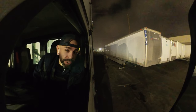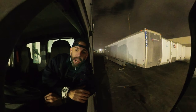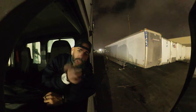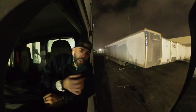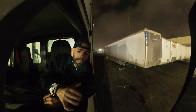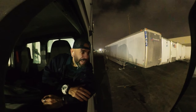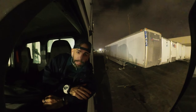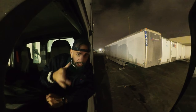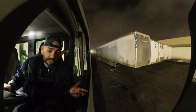Like right now, guys, it hooked pretty good. I noticed that the first trailer that I hooked up to with this tractor this morning, I backed up to it, and when I tugged it, it just went forward. It didn't grab. So I went back again and it hooked, and I checked the hook and it was locked. And that trailer, I had it all day today. I dropped it off and I grabbed an empty when I came back the first time here. And when I hooked up to that empty, same thing happened. I backed up to it. The pin hit the fifth wheel. I went forward. It didn't lock. So I did it again and then it locked. It was kind of trippy. But then today when I came over here and I dropped it and then I hooked to that trailer, the one we took earlier over there, same thing. And then when I grabbed that empty that we just dropped off right now, same thing. And then this one, it didn't do it this time. Kind of weird. I don't know if it's messing up or that's just something that the driver has to get used to doing. I don't know, but I don't feel safe doing that.